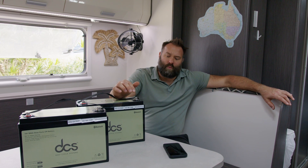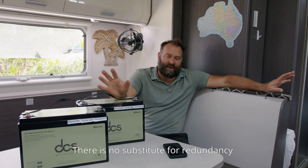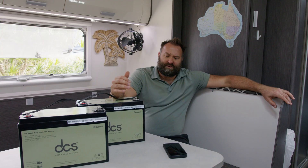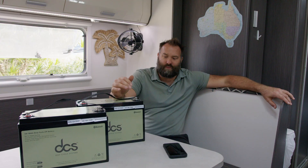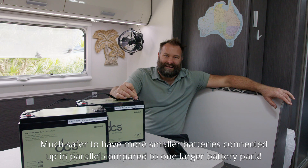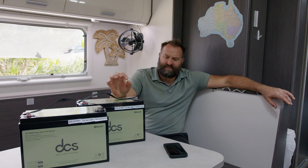The reason for that comes down to safety. If you have one big 300 or 400 amp hour battery pack in your caravan and you lose one cell, you've got no battery power — so redundancy is obviously a major factor. But safety is critical. You want smaller capacity batteries connected in parallel for safety reasons. If one of these cells is going to let go into gas, you've got no chance of containing a big battery cell when it decides to go to thermal runaway. The smaller the capacity of that battery cell, the less damage it's going to cause.